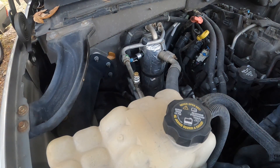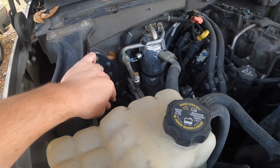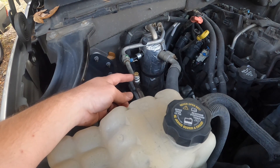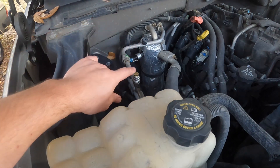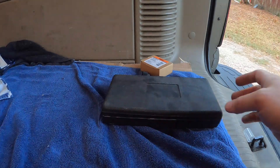If you're looking for one, I'll put the link in the description. I ordered it on Amazon, got it the next day, under 10 bucks — I think it was $8.99. You may be able to get it at a local auto parts store. As long as it stays not leaking, it's going to stay like this. This is a nice solution — you can still use it as a service port, just unthread the plug, check your high-side pressure, and when you put it back it seals right back up.